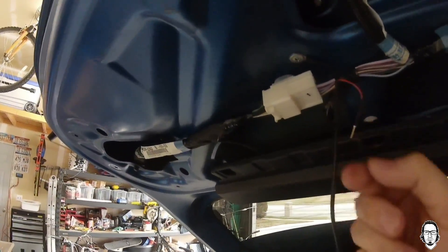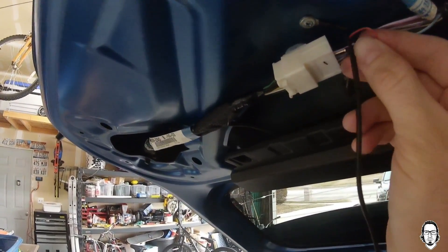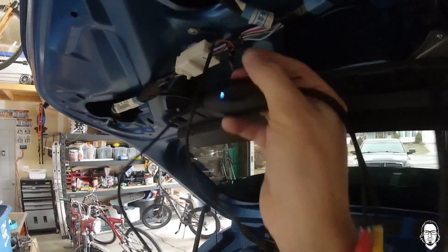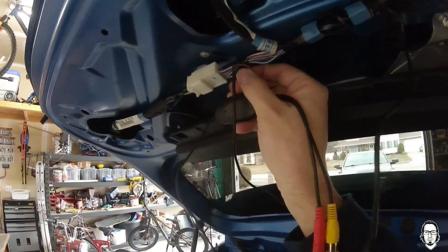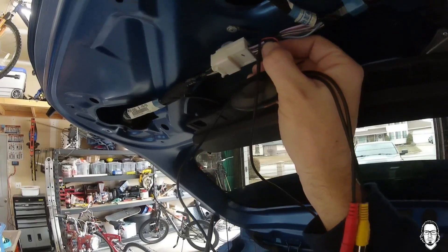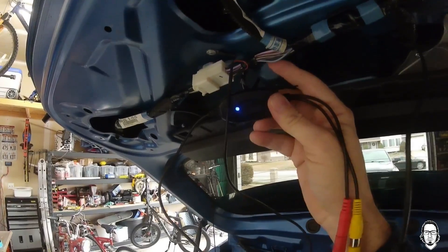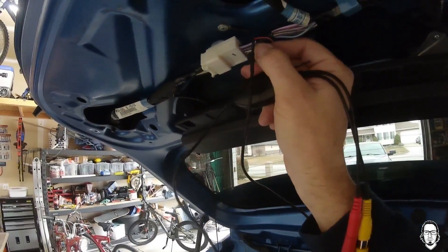I soldered this on, cleaned it up nice, and I'm just going to go through these and see which one turns on and makes my device work. How I know is this blue light turns on — if I disconnect power the light goes off. I'm looking for which terminal will turn on because I want power on all the time, not just with the lights. I could not find a wiring diagram for my model Prius without paying, so I'm just doing trial and error.